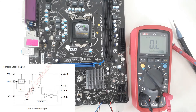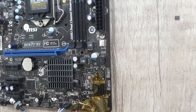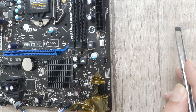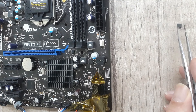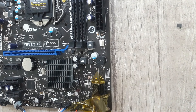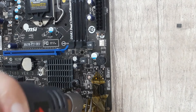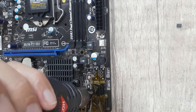I want to change the burned regulator IC now. I got a similar regulator IC from a scrap motherboard — mine was UP7706 and this one is UP0104P. I checked them on the datasheet and they match each other without much difference. I remove the regulator IC from the mainboard. Make sure to cover surrounding components with heat-resistant tape so they won't get damaged or burned. After removing the regulator IC, make sure to check whether the short circuit is solved or not.